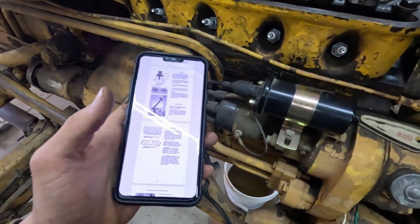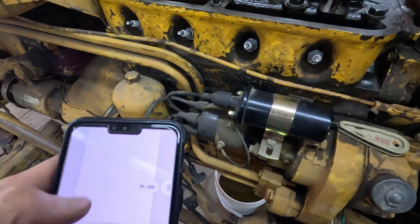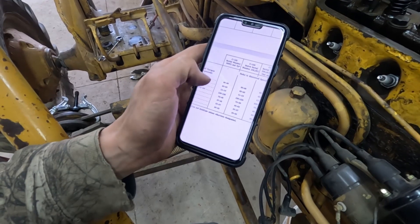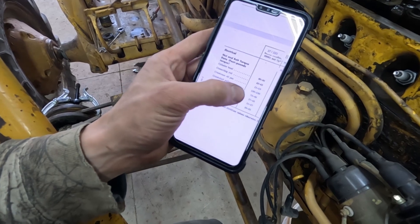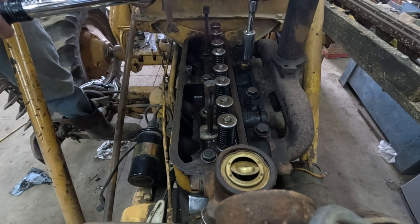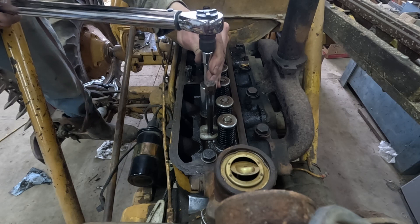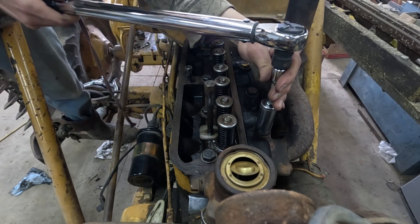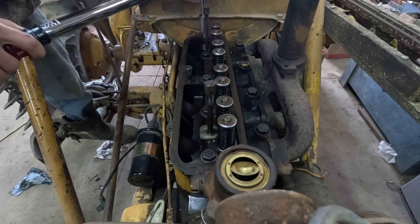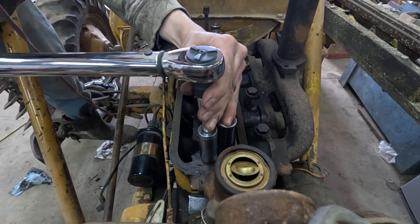We know it's supposed to go to that torque specification because our engine serial number is 97995. Listed under nut and bolt torque data in foot-pounds: for a C123, serial number 65001 and up, it's 80 to 90 foot-pounds. So I'm going to do 20 pounds for the first pass — going through bolts 1 through 9.